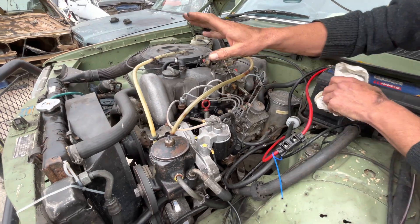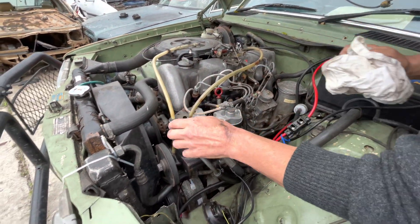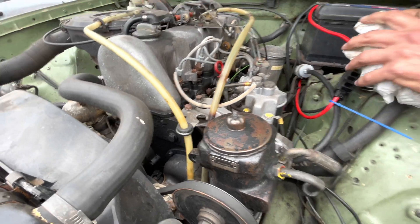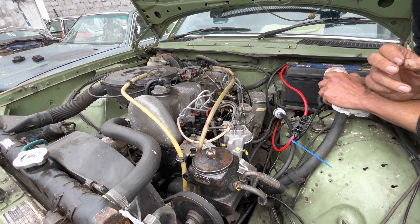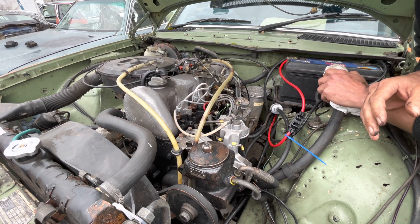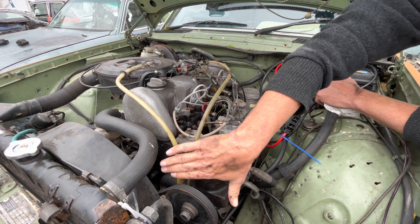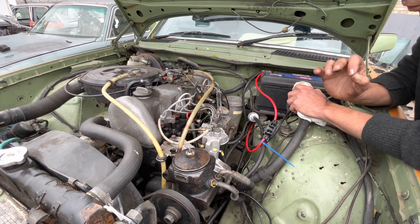A very simple system. Things that can go wrong: you're basically looking at a failed vacuum pump here. The diaphragm inside tears very often. They are available new from Mercedes for a few hundred bucks. That problem would manifest itself by the brakes being exceptionally hard — it would have no boost. A very hard pedal and difficulty braking would point towards a vacuum problem with the vacuum pump itself. Assuming your brakes feel alright, your issue lies elsewhere.